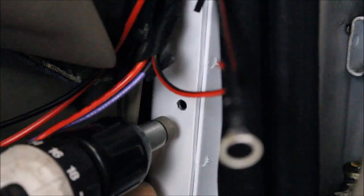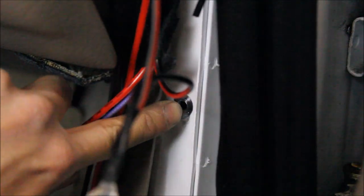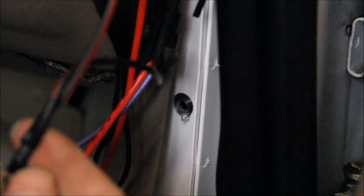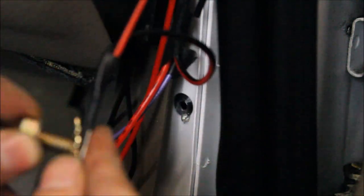Let's take care of the ground now. We have both our wires for the camera and the mirror coming into this ring terminal. We soldered it, crimped it, and put some shrink tube over it to make it look nice. I've already piloted a hole onto our chassis but we have to remove the paint. I've put some dielectric grease down over the paint because it displaces easily and it's going to prevent any corrosion down the road. Then go ahead and put our washer on first to stop the bolt from backing out, and put our grounding bolt in.